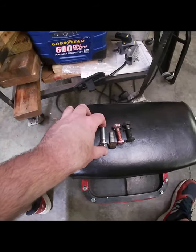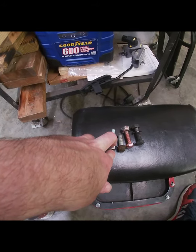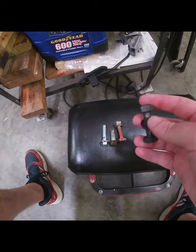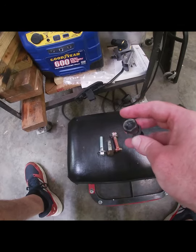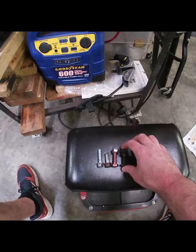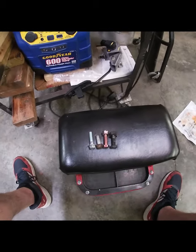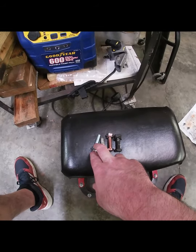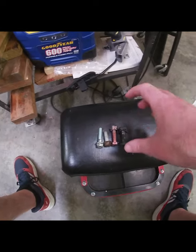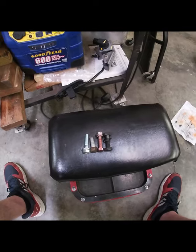So something to pay attention to, guys: if you are doing something custom like putting in different axles, pay attention to your bolts. Don't just grab any bolts, especially for something like an axle or a driveshaft — you're going to snap them off, and that's going to be a bad time. This is something I wanted to share personally. We wasted a little money and broke quite a few bolts until we got the right ones. Always do your homework and get exactly what you need.